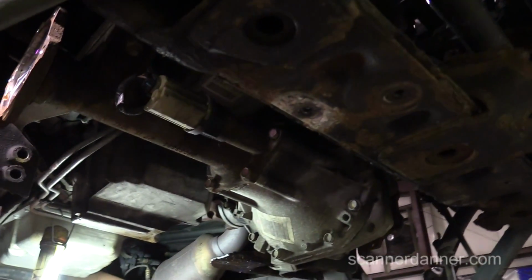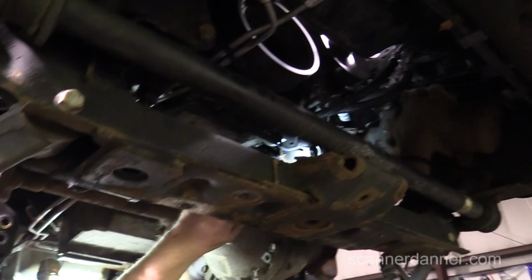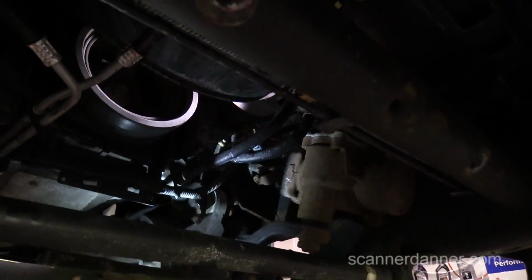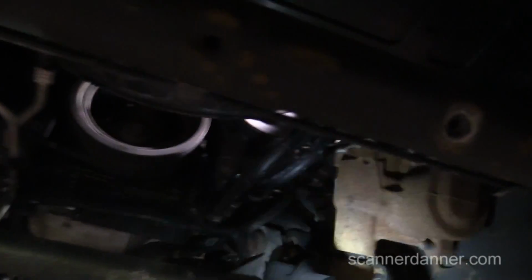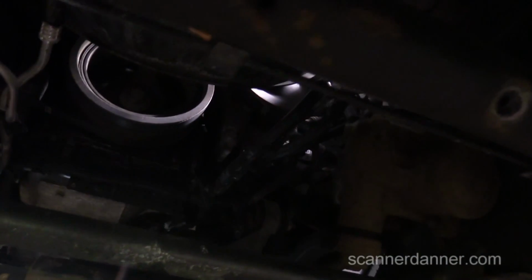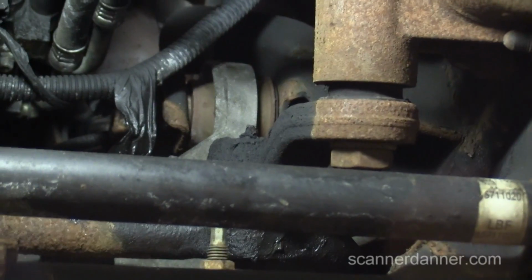Okay. Let's get this electrical plug before we forget. See that bolt up there? I'm making you do it. And you don't need to film that. I'll leave the camera running. Get that bolt out there. Then we're going to loosen this one, and then loosen these, and then we'll get a tranny jack and just drop this whole thing out of the way.